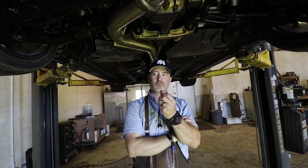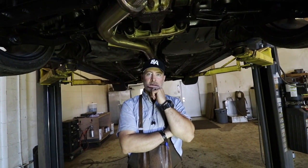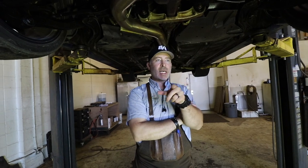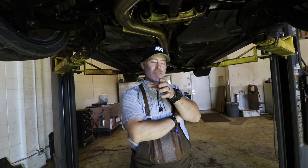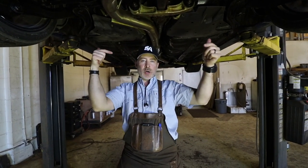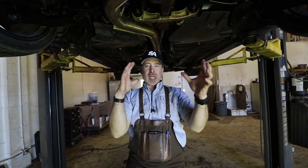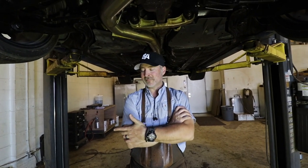Essentially, if there's cheap undercoating underneath your car, the dry ice will pull off any coating that's not properly adhered. Ted confirms this applies to paint as well — if paint has lost integrity, whether from age or rust blooms pushing from the back, it will lose adhesion and get blasted off, then dealt with in additional ways to preserve the metal longer. His advice: get this done as soon as you get your car.